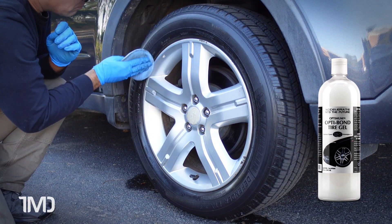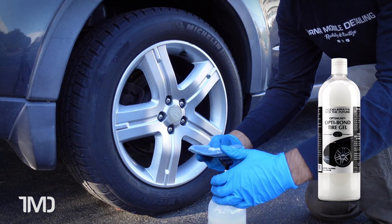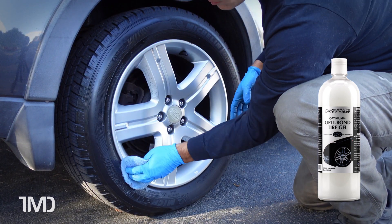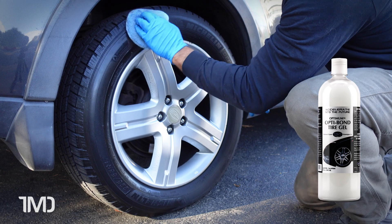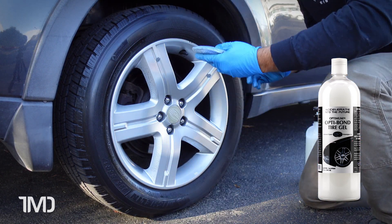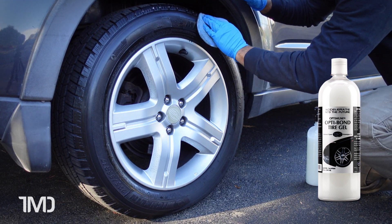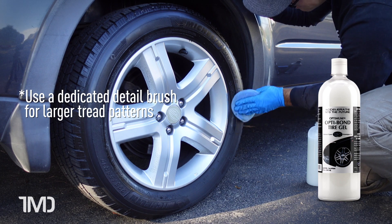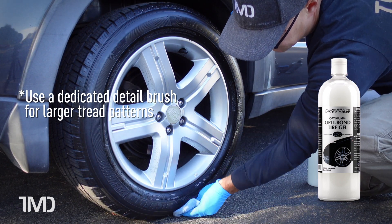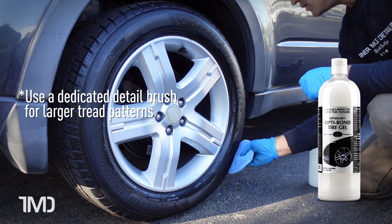It's a little bit on the translucent side so it blends in with the tire a little quicker. All in all, it's very easy to use. I typically put about two to three dime-sized dollops of product on my applicator pad at a time, and work it into about a quarter to a third of the tire. With this kind of tire dressing, take your time, rub it in, get it in all the treads, don't try to rush it. As I'm applying it and rubbing it in, I'm seeing that it produces a nice satin to semi-gloss finish.